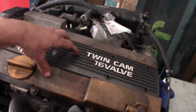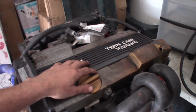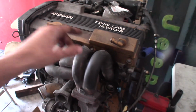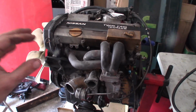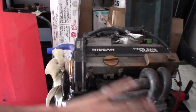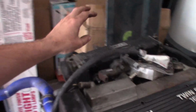Now, I freaked out because I wanted to go to Black Friday. I bought a whole other CA and I ended up getting a whole other ECU. Now I think this CA is still going to have some life left in it because I honed this block, I put new rings on it, and I thrashed it, and we were having zero issues up until that ECU problem. And then obviously I swapped that whole other CA in there with that T2528 from ISR, and then I swapped over my shaved manifold and stuff.